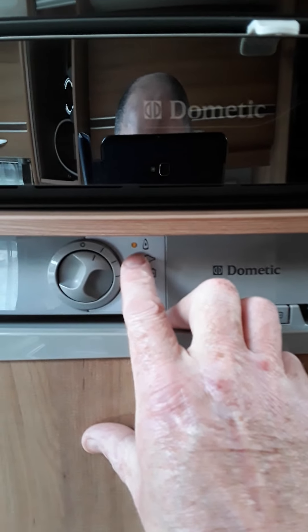Outside here - if you're wondering what this is, that's just the exhaust off your heater. Coming along here, this van has got airbags on it. There are little valves here at the side and you can put air into each of them, putting the same pressure on each side. The maximum pressure is about 60 PSI, but you can run it at about 40 PSI to inflate the bags, or let them down completely. Always try to keep at least 10 PSI in the bags - don't let them go completely flat, just to keep the rubber from getting damaged. You can raise the van up and down with that and it'll stiffen up your suspension a bit as well.